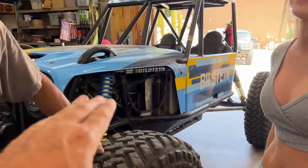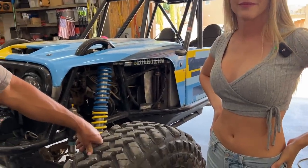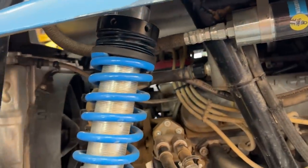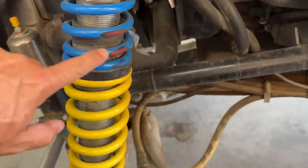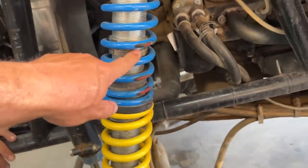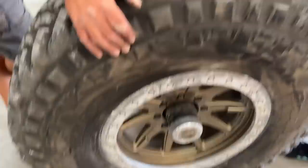It's useful to have — everyone always asks and I'm like, huh. So we did have it higher and he was like, you need to lower it. It doesn't need to be that high. It's a buggy — you want it low. So I dropped them all the way. I dropped the fronts as far as I could and that's as low as we could get. So we need different spring rates. But if you see here at full lock, since we changed her steering setup, she actually rubs the springs on the tire. So we probably need one-inch wheel spacers on each side.